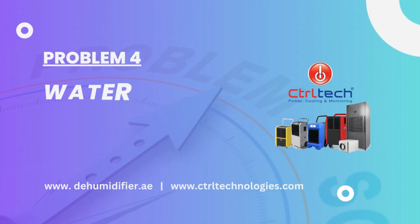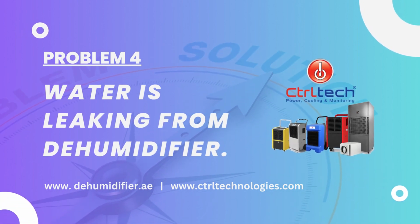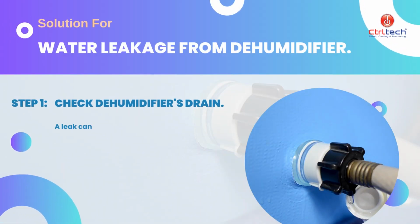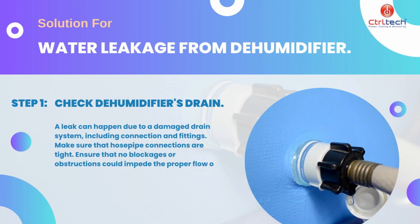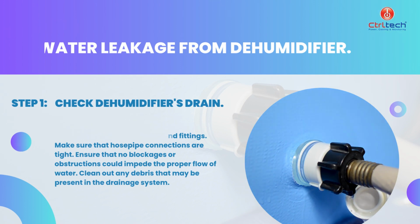Water leakage from your dehumidifier can create a panic situation. So, let's see how to solve this issue. To stop leakage, first we need to check the drain system of the dehumidifier. A leak can happen due to a damaged drain system, including connection and fittings. Make sure that hosepipe connections are tight. Ensure that no blockages or obstructions could impede the proper flow of water. Clean out any debris that may be present in the drainage system.